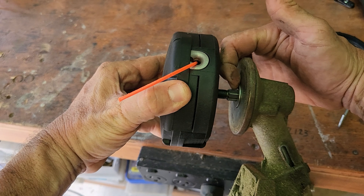You might be thinking, how does this unwind? If you're not familiar with how bump systems work, it needs to be bumped. Look at the play that we have here. If you want more cord to come out, you bump it down on the ground, and more rope will come out. This is when it's spinning - due to centrifugal forces, you bump it and a bit more rope spools out. That spring mechanism and the play we were looking at - that's the way it works.